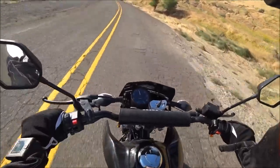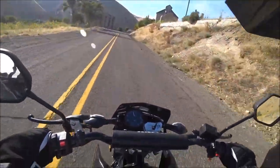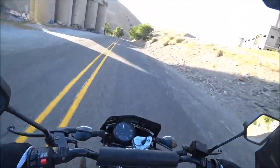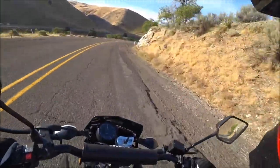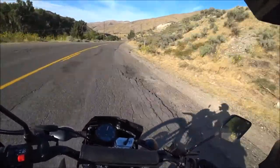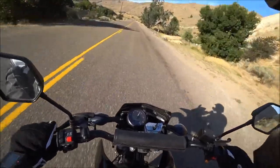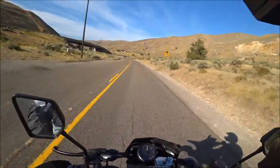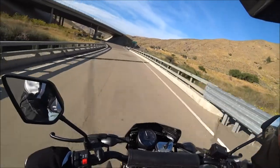Okay, I just geared down to fourth. In fourth, I'm doing about 38 at 4,500 RPMs. So, depending on what gear you're in, the RPMs change, right? Yeah, 40 at 4,700. I think this thing's pretty dang close. I'll have to get the phone GPS app and try it out against either the Jeep or the van and see what they do. Fifth gear, 61. I like the sprocket though. Going over 50 in fourth is nice, it has a little bit of gump to it.